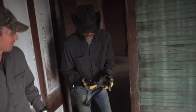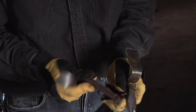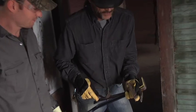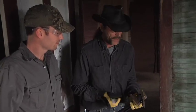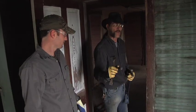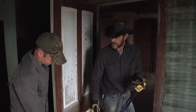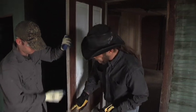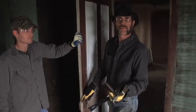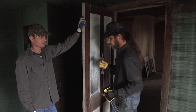Save these. These little pieces right here, they're called the keepers. These keepers retail in an architectural store for about $5 to $7 a piece. The other side is no good without it, so you always want to save these. They're all different sizes, so just hitting one doesn't always work. Salvage miners generally don't take these, and you end up with that other side which has the box on it. Why would you take half of something when you can't make one of these to replace it?